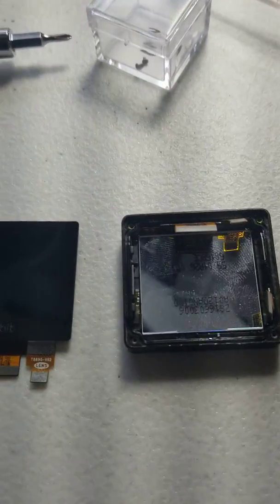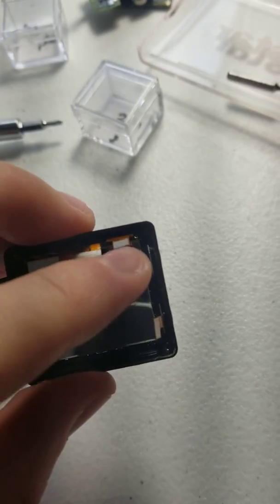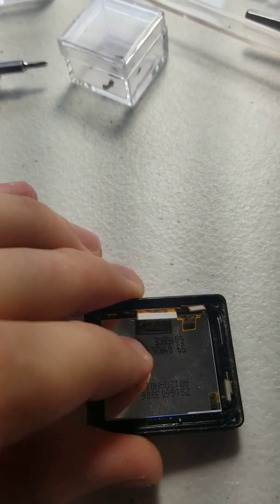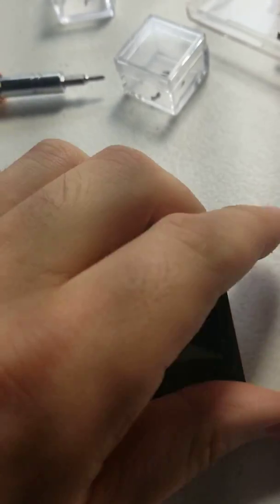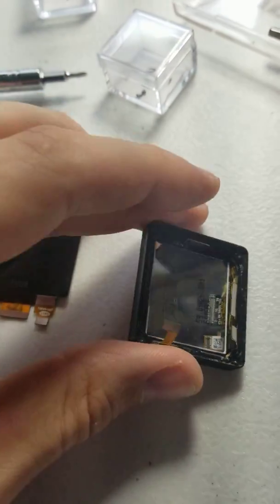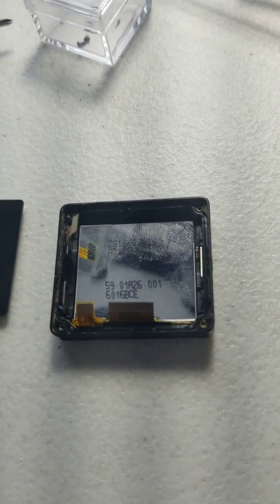Finally, after searching for quite a long time, I haven't found this step, so I'm going to do the step from here to remove the actual LCD display — we've got a cracked one. You want to push lightly in each corner on the old LCD. We want to push on each corner of it to loosen it because there appears to be a ring of glue around the outer display that holds it into place. So loosening that is tricky, but if you're replacing the LCD, it's hopefully already broken and you don't have to worry about cracking it. Give it some pressure in each corner, you'll feel it loosen, and then the front should come out.